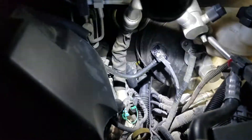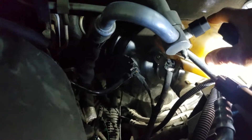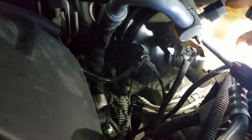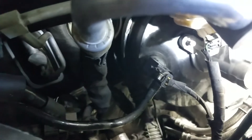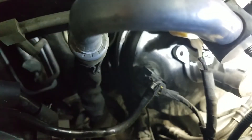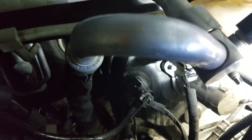That hose needs to have vacuum pressure and goes into the brake booster. My question is: do you guys think it's normal that if you remove the brake master cylinder and suck air through there — what do you guys think? Do you think I found the problem for bank 1 and bank 2 lean condition?